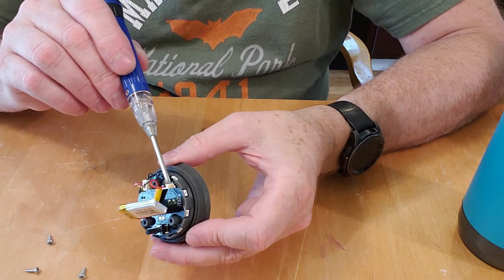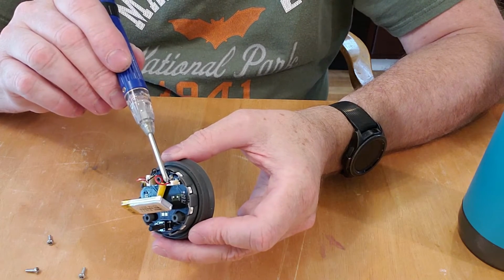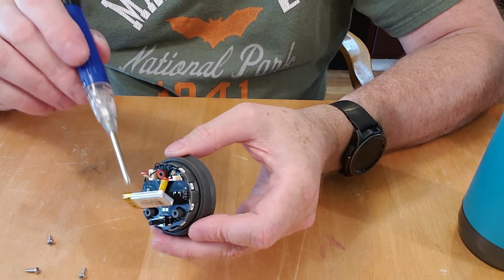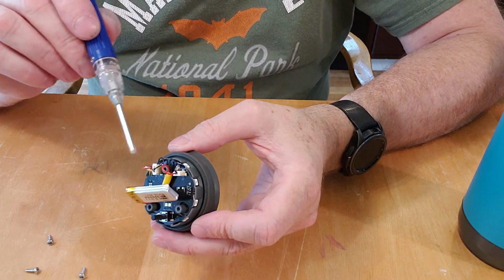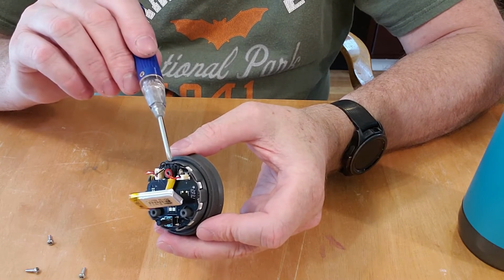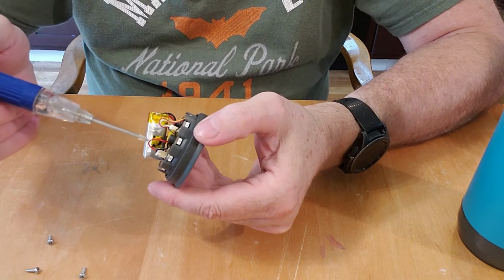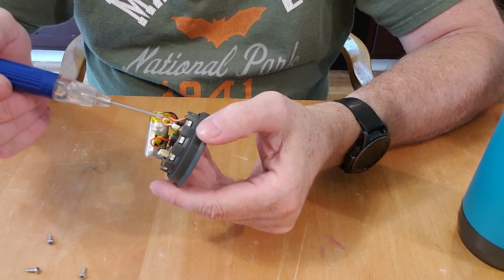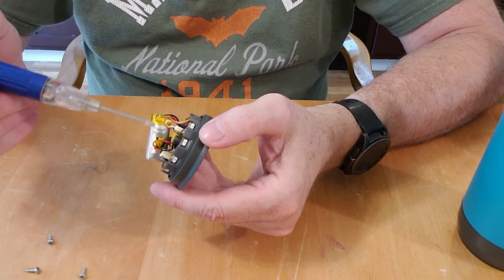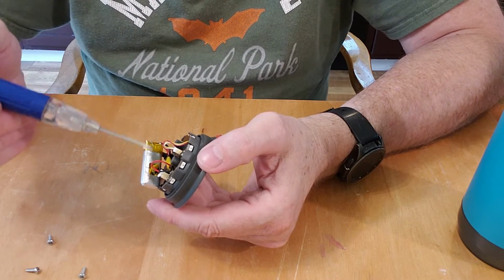They used a smaller one, a JST SH 1 millimeter pitch. So this is a smaller connector than what you normally get on these batteries. So you're going to have to clip the end off of your battery, clip the end off of the old battery, and tape them or solder them together. And these wires are so small, I just decided not to solder them, just to tape them. Because there's no current running through here to speak of, really. It's just make sure to really tape each piece good.